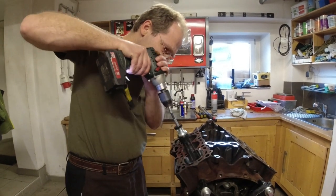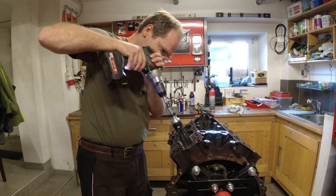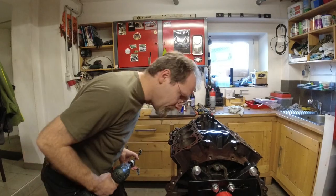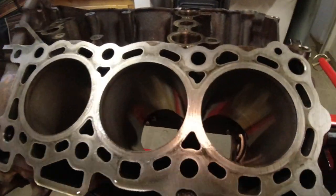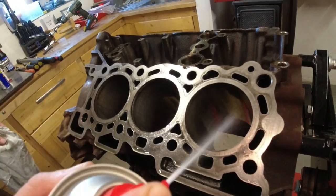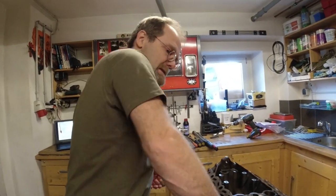It clearly shows the disturbances are going away. The scratches are also not quite 45 degrees — more like 30 degrees. I think we're doing good from the angle. That was like 40 seconds of honing. I'm happy — as long as it didn't take off any material. If anything, it's maybe a micron.